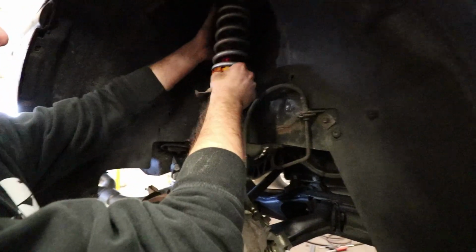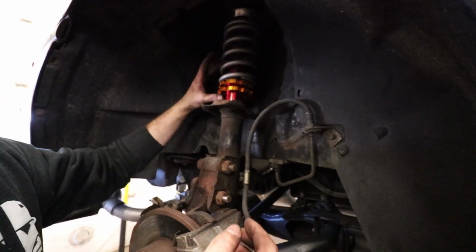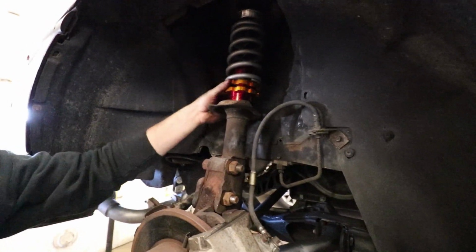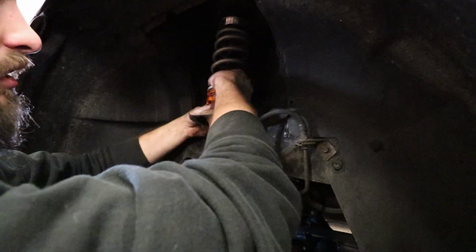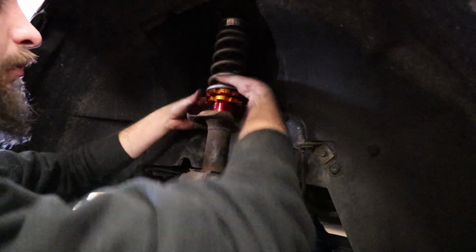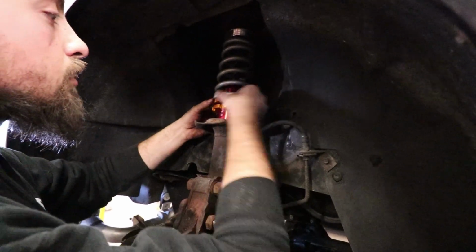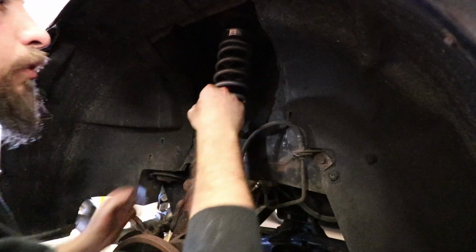We'll just have to help that into place on each wheel. So I'm going to start about midway on the little coilover adjustment. That way if we need to go lower, we can, or if we need to raise it up, we can. Just a good baseline for it. We need those adjustment numbers out so we can see where we're at. So we're going to be sitting right at the top of the number 4 on the 40.